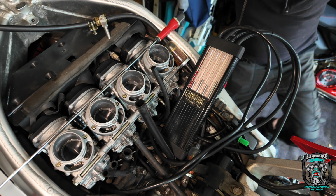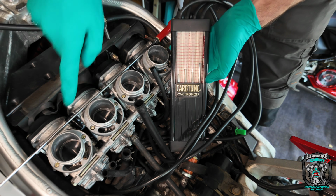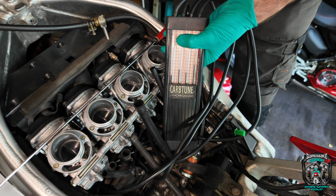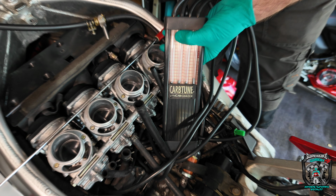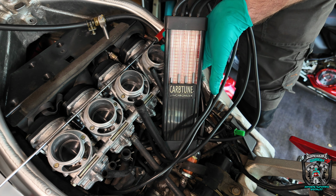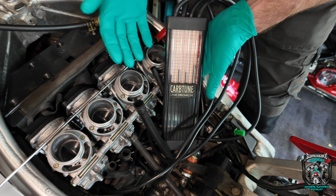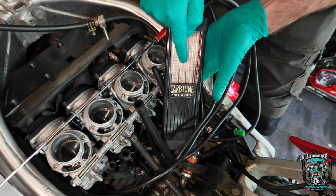Right, I don't want to go down a carburetor balancing rabbit hole right now, but see how they're out of balance. They were as close as I could get them on the bench, just by eyeballing them. People say have the revs up a little bit, so we're at about 1300 revs now. If I raise the RPM a bit, look how the gauges are reading now. At lower RPM, the amount they're out of balance is amplified. Does that make sense? Anyway, that's not what this video is. Let me get it properly warm and let's synchronize them, and then that'll be the end of the video.